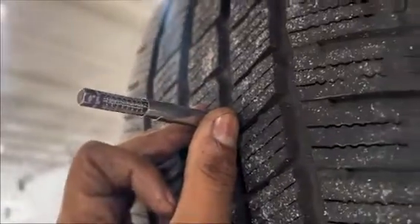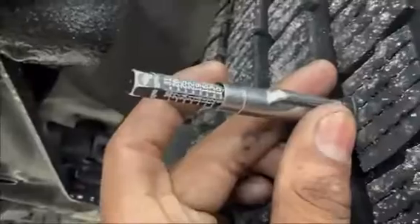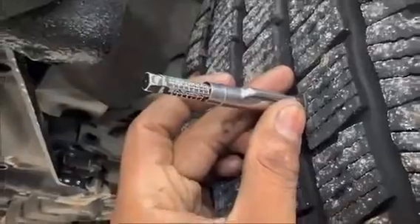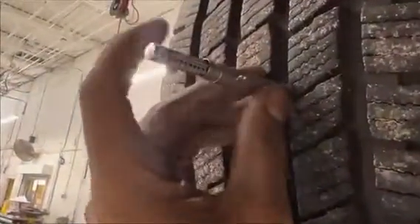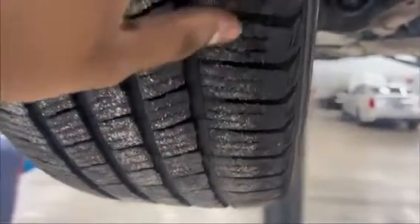Let's get started with some brakes and tires. Your tires are in pretty good shape. You've got 7 to 8 32nds in the rear and about 9 to 10 in the front. The tread is all wearing pretty evenly, so you're good in that department. There's a slight bit of feathering, which can be indicative of misalignment or tire imbalance, and that should be something you might want to look at in the future. But overall, your tires are in good shape.